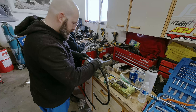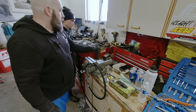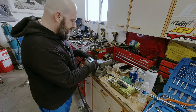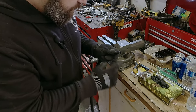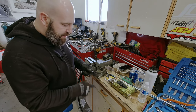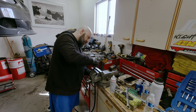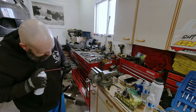Now that the electrical wiring is complete we move on to building the transmission cooler lines. Taylor's E92 has an upgraded side-mount oil cooler so we need to adapt it to the eight-speed. We put some electrical tape around the hose, put it in a vise, and cut it with a sawzall - this way it doesn't fray. Clean up the edges, lube up the AN fitting a little bit so it goes into the hose easier.